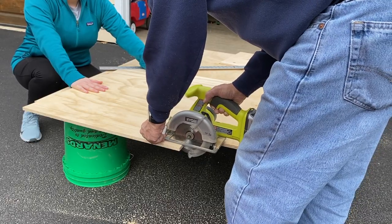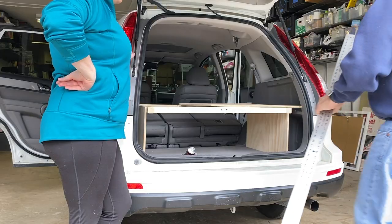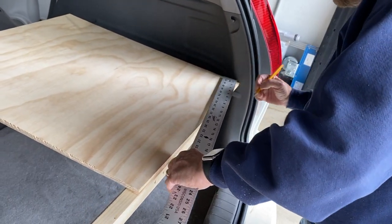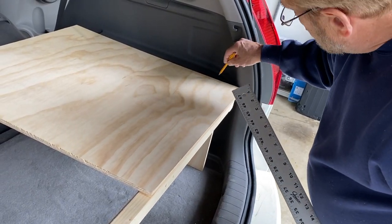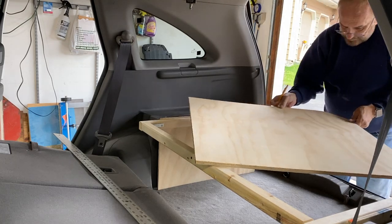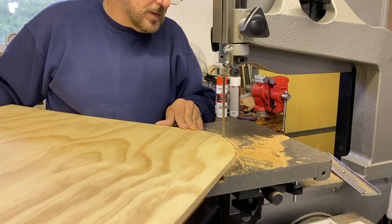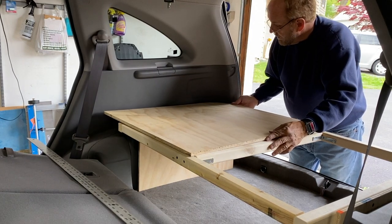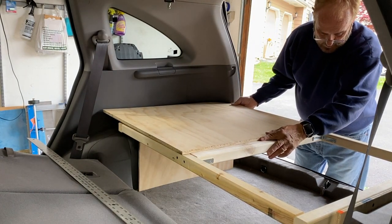Each car has a unique set of measurements and challenges to work around. In my car, my spare tire is underneath the floor of my trunk, so we knew that the trunk section had to be easily removed if need be. The next step was measuring and cutting down our plywood to sit on top of this frame. Since the door opening is narrower than the width of the trunk, we decided to use two pieces instead of one. These pieces span from the ledge of the wheel well and meet in the middle of the 2x4.